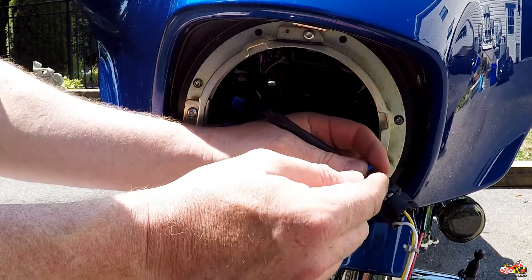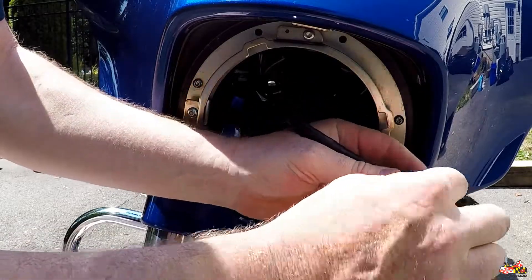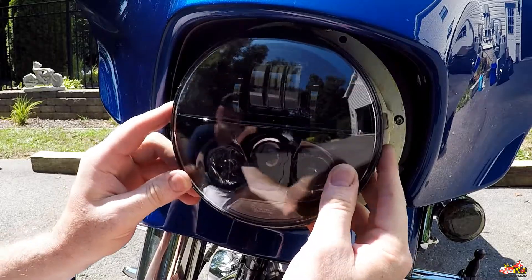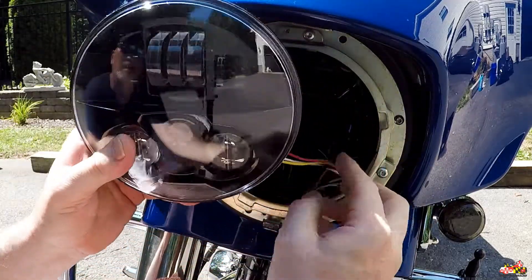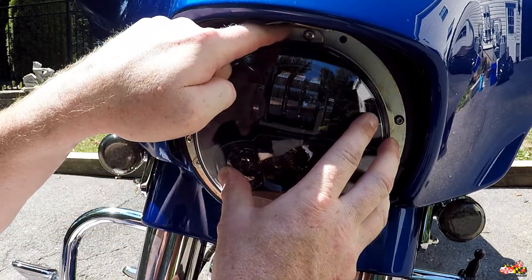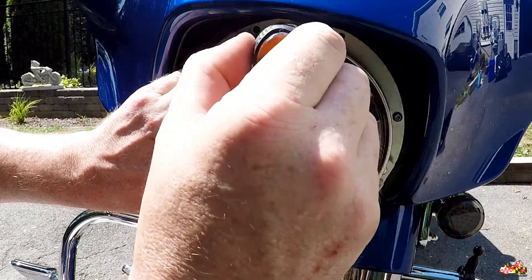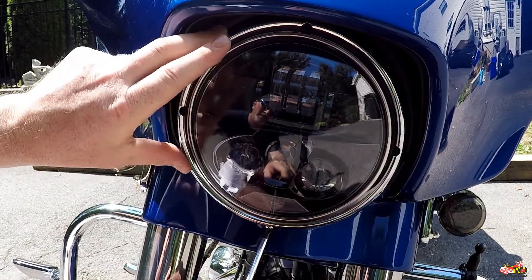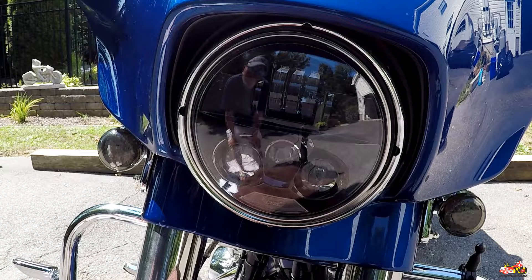I got the adapter back in and have electrical tape on for wire management on the adapter and the headlight. All you have to do is plug them in together — it's a good tight fit — then put a little electrical tape around it just to hold it, though it's very secure. To put the light back in, there are three little notches on the back of the unit that slide into your inner ring. Locks right in. While holding it, put the inner ring back and replace the three screws. Then put the outer ring on and you're done. I leave the screws in the housing because holding the light up while trying to insert a screw gets challenging. Make sure you have a good seal on your gasket, find the hole at the bottom, and screw it back in. Looks sweet.